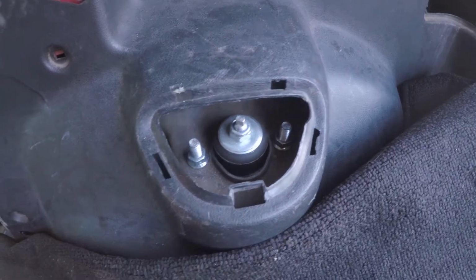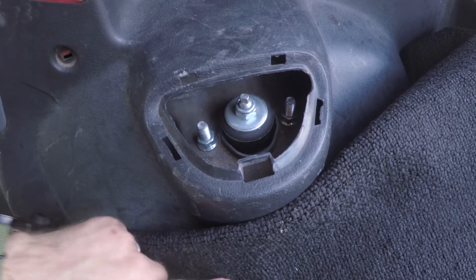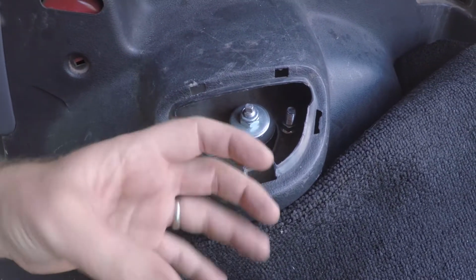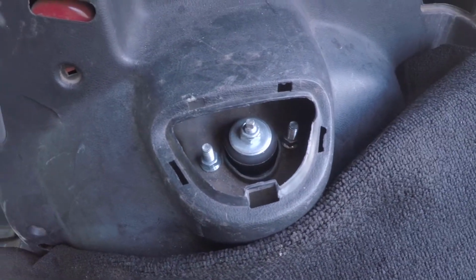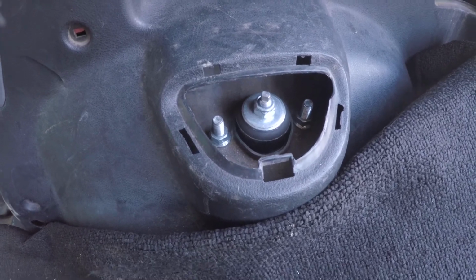So coilovers are theoretically really easy, right? It's just drop these 2 bolts, and then there's another bolt connecting to your lower control arm, and the whole thing should just drop out, and then you can adjust freely. But again, that's all theory for me. I've never done this before, so we're gonna find out.